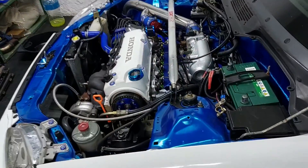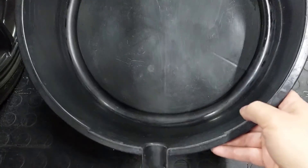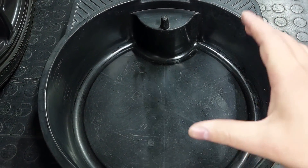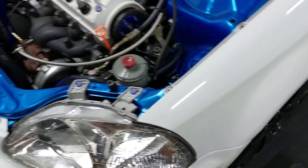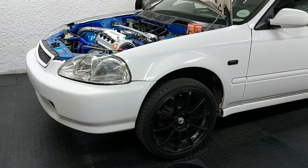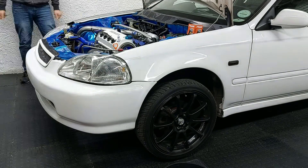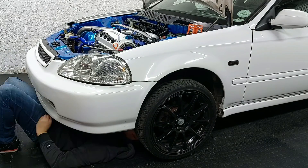What I'm going to do is change the oil and show you guys the catch can install once I'm done. Then I'm going to drive it to work tomorrow to make sure everything is fine. We have a clean oil catch pan so we'll be able to inspect the oil and see what it looks like. It does look kind of new on the dipstick because we changed the oil after about two heat cycles. The oil that's in here has done about a thousand to fifteen hundred kilometers — not really sure because the speedometer wasn't working for some of that time.